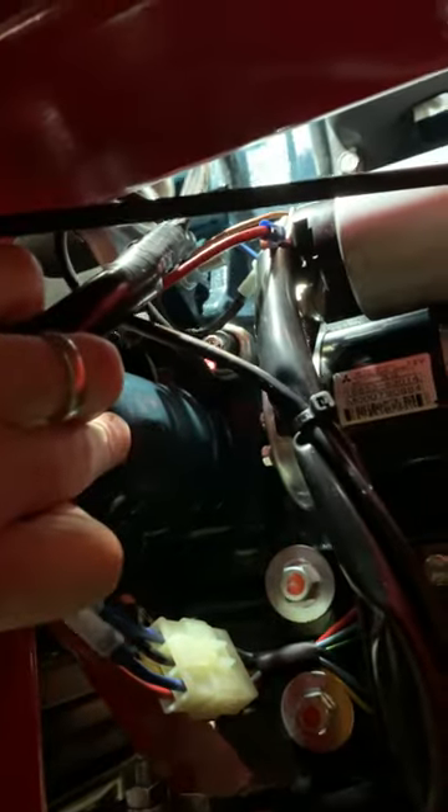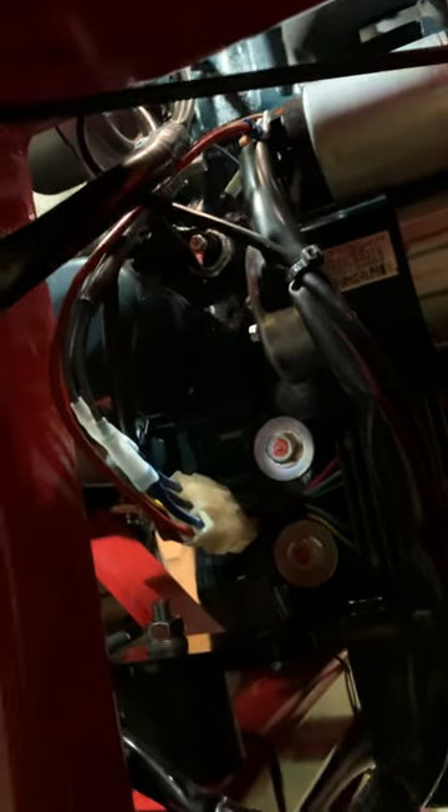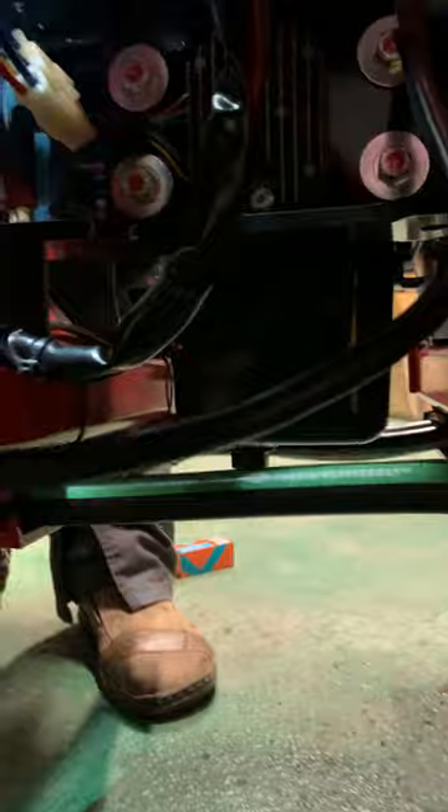It's a different color one on this now but it's a gray color — you can see it just there. Grab that and rotate it; it's a normal oil filter. Take it off and put your new oil filter on in that location. When you're here you can also see the sump with the sump plug underneath there — you can get to that from the far side, which is probably easier.